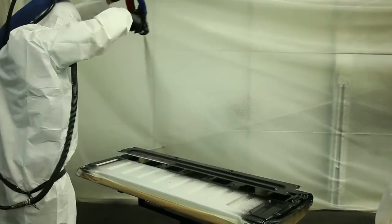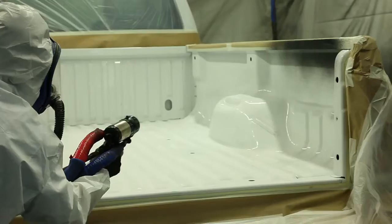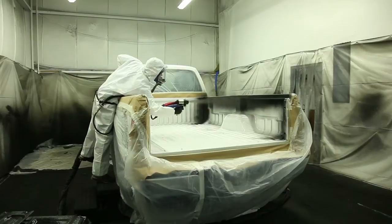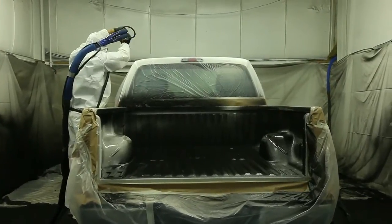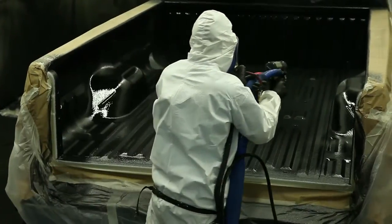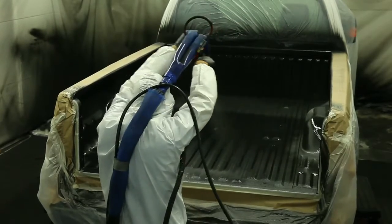Spray the rest of the tailgate by applying smooth glossy layers with a 50% overlap to a proper build thickness. Now let's spray the truck. Step toward the back of the truck and apply a light layer of Rhino Linings material under the bed rail on each side of the vehicle. Spray the corners and sides of the truck — this is most easily done from the opposite side of the truck using a step stool. Next, coat the floor of the bed, then the top rail of the bulkhead closest to you. Repeat the last three steps on the other side of the truck bed. Move to the back of the truck box and coat the bulkhead and the backs of the wheel wells. Then coat the floor again from the back of the truck, starting just in front of the fender wells. This allows for even thickness over the entire floor of the bed.